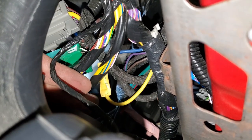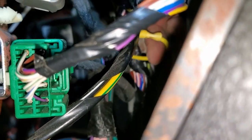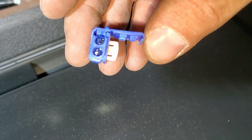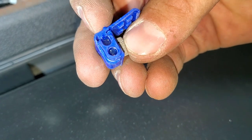I finally got it — that yellow butt connector there, that was a pain in the butt but I got it. What I did is I took and cut off the heat shrink end, then I used a pick and pulled the two wires out so I had a little bit more room to strip them and connect them together. A much easier way to do it — and I know some people have — is to use one of these, it's called a scotch lock. Just leave that heat shrink end on it, put both your wires inside there, pinch this down with needle nose pliers, fold this over. It'll work just as good and be a thousand times easier. That's what I'm going to use when I do my chase light.